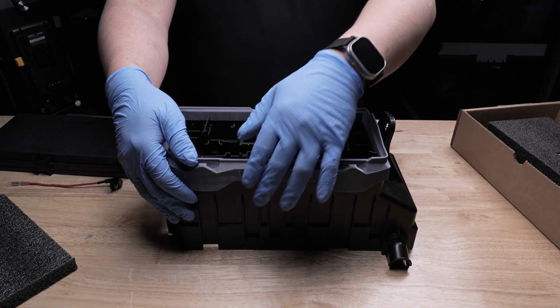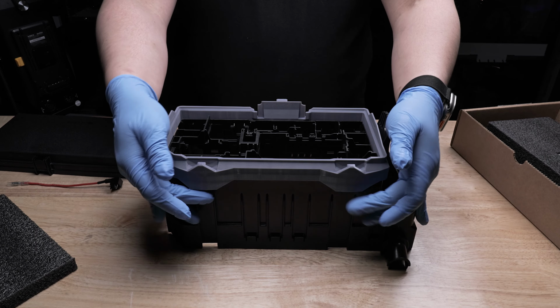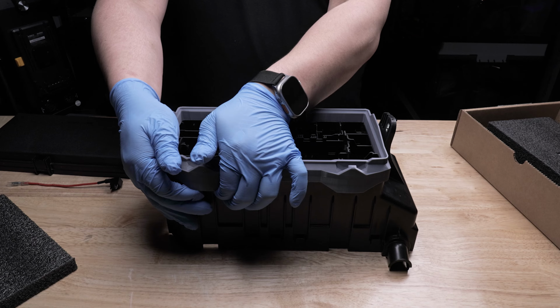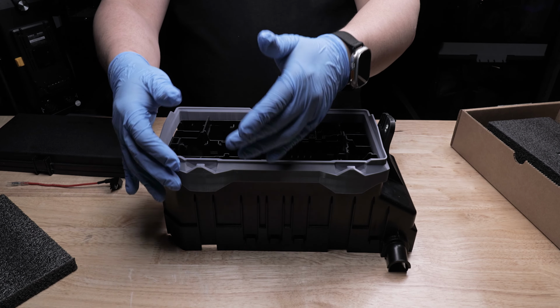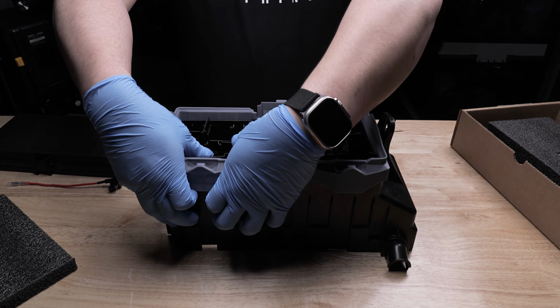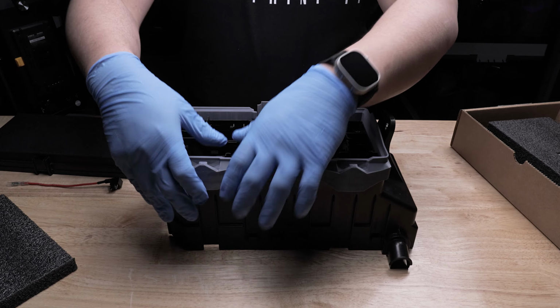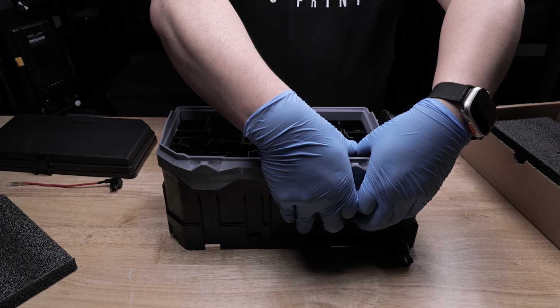The removal process will start by you basically taking your fingers here, finding your way underneath these 2 large tabs here. Grab here with both hands, peel upwards. I would also recommend that if you're unable to peel it up because it's really stuck, to place your hands inside the fuse box, so you have a little bit of leverage. And then just peel upwards like that. The other side over here, same thing. Go over there and just peel upwards.